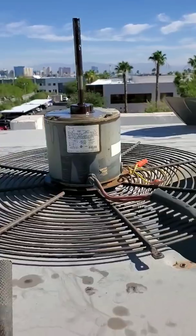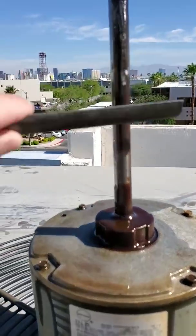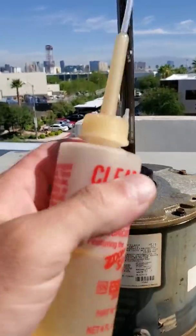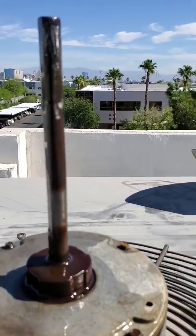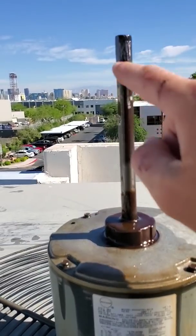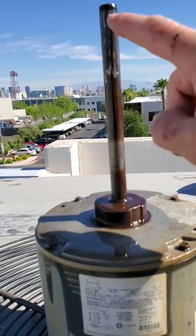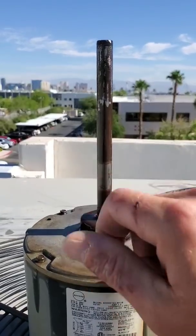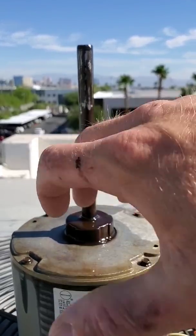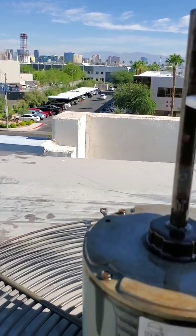I got it removed. I just flipped it over since that part was face down. First we're going to undo this — that's what holds your fan blade in place — so we need to take this off first, take the fan blade off, and then we can start unmounting the motor itself. Before taking off the blade, I recommend cleaning up the shaft a bit with some sandpaper or a file, and then put some oil like WD-40 to make it slip off easier — it just gets built up with rust.